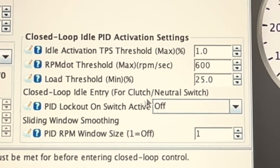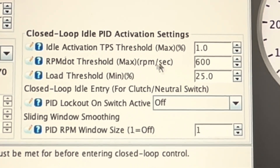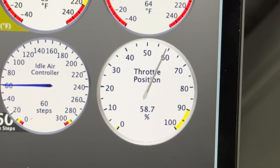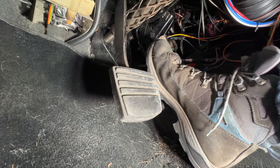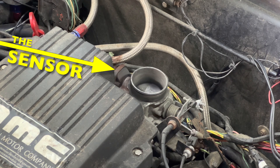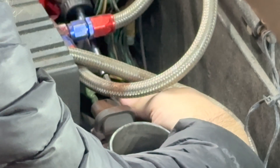At some point when I was poring over the settings in Tuner Studio, desperately trying to figure out what I was doing wrong, I noticed there was an option to only idle when the throttle was below a certain level. And then I noticed that my throttle position sensor wasn't showing zero when I was stopped. A throttle position sensor is just what it sounds like — you push the pedal, the throttle opens, and the sensor reports how open it is. When you let go, it's supposed to spring back to close with the throttle, but mine sticks open. I've tried three different sensors and they all stick, so it's not the sensor. None of them spring back until I loosen the mounting bolts, but then it creates a vacuum leak.